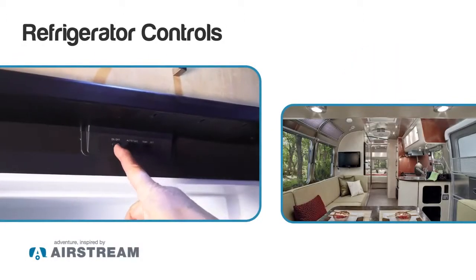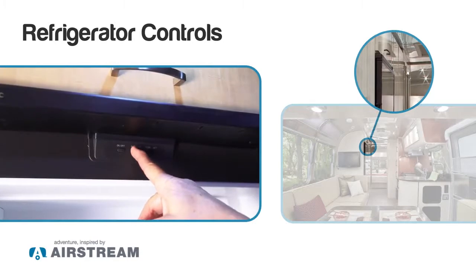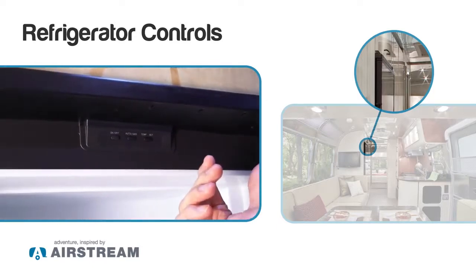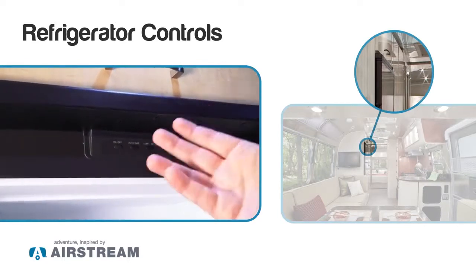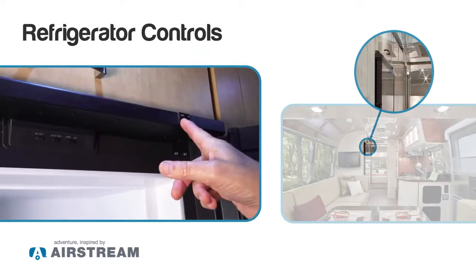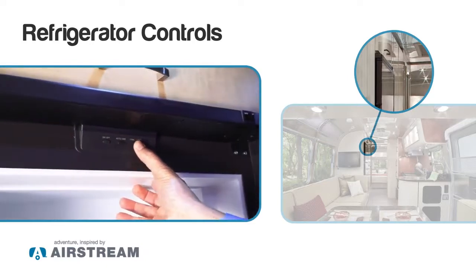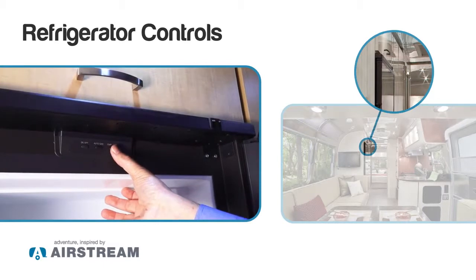To start with, there's an on and off switch, and you activate the switch. Then the default, when I press the auto button, is going to be 110 volt power. If it does not sense any 110 volt power, it's going to switch over to propane. If neither one works, the light after a while will start flashing, telling you that you have a problem. There's also an indicator over here that if it's on automatic, there will be a little light on this display. If it's on propane, the light will be over there. There's also an indicator if you want to set the temperature; there's 5 different zones. You can toggle through, with 5 being the coldest.